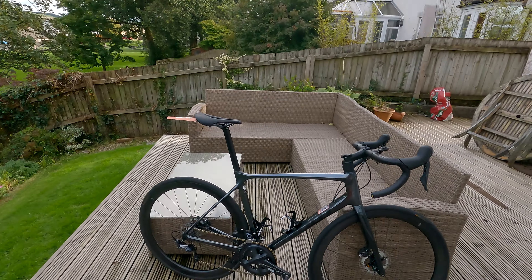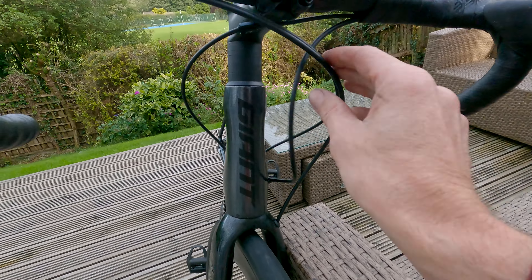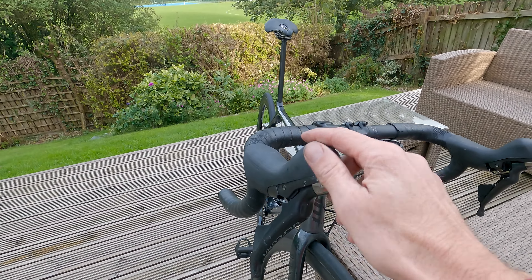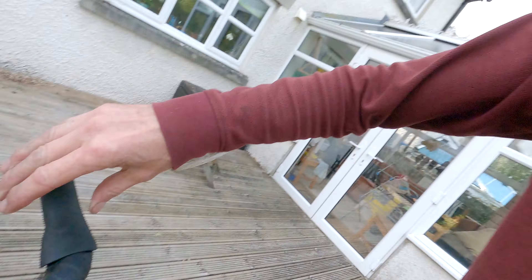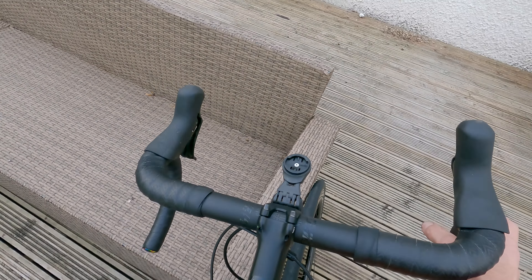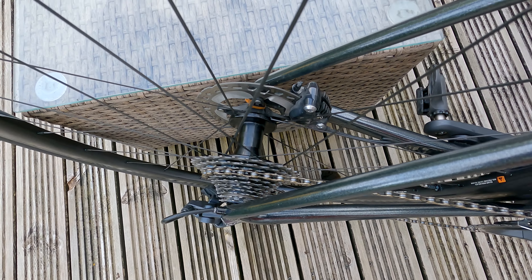One thing I genuinely don't like is the cables. I should have gone Di2 or another wireless groupset to get rid of them — that's on me, I was at the top of my budget. Going Di2 would have been hundreds more. I also had to change the rear mech cable after 2,000 miles — it was utterly done, down to the last three strands. It felt a bit stiff again recently but all feels fine now.